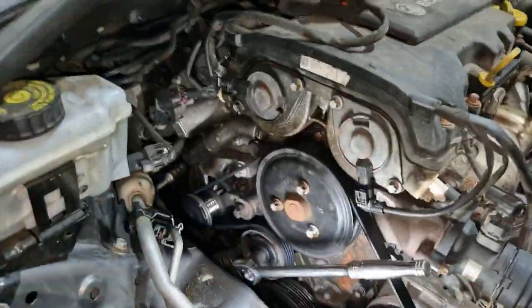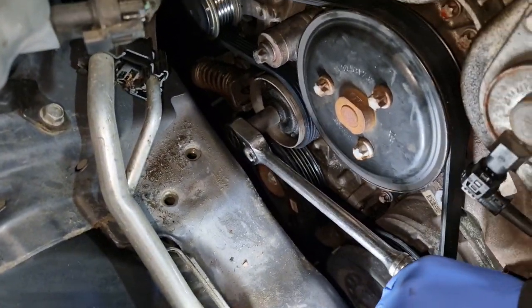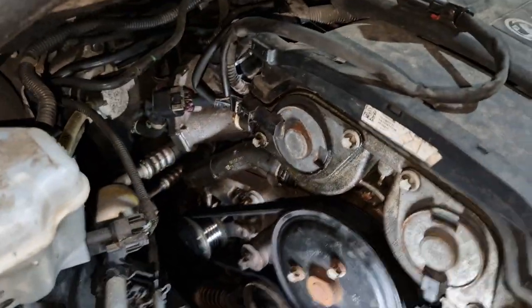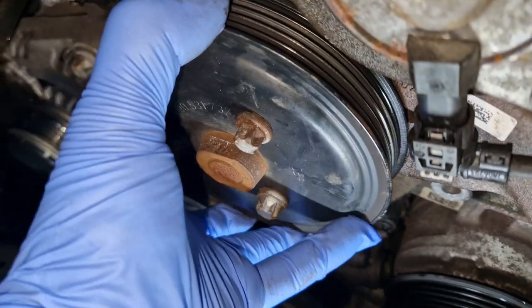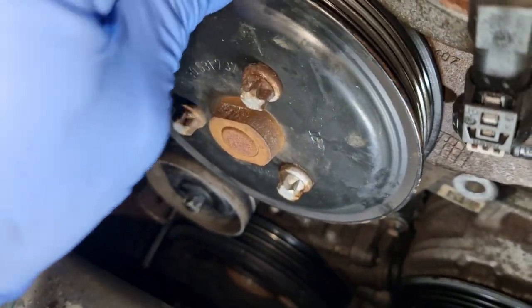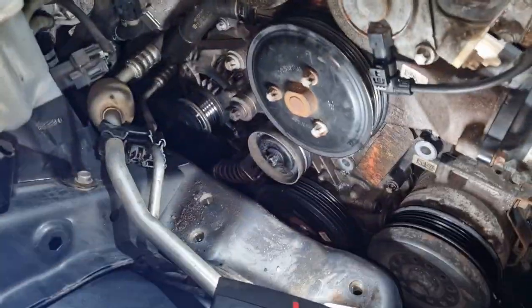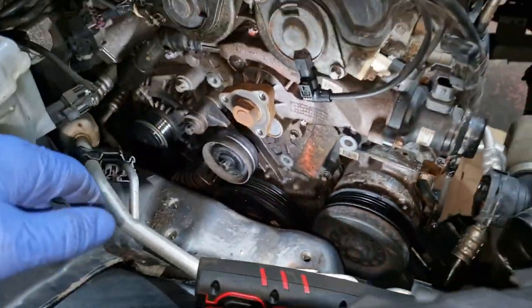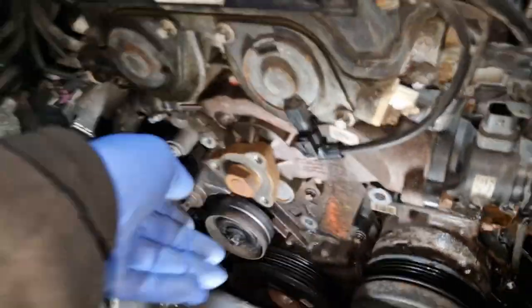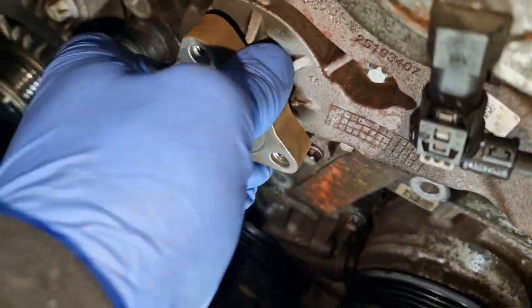Right, we've got the wee Corsa. Show you how you do the tension off on these ones. Push down, see the big spring. Just a big spring on this one, so we'll get this belt off. Right, belt's off. Knackered. So get the pulley off it. Right, so that's that off. Pipes off the front. Got a bucket under it. Wasn't much coming out at all. A couple of drips. You can see, definitely knackered. Bearing's knackered in there.